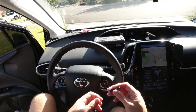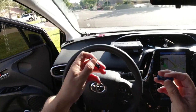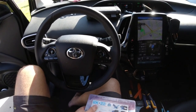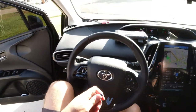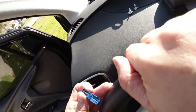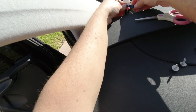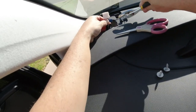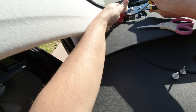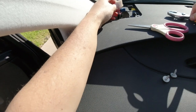We're going to take two of these connectors and crimp them onto those wires, and then we'll just be able to plug everything in and see if it works. If there are sparks coming from it, then we know I did something wrong and I'll end the video. Remember, the positive is the lighter of the two — the lavender and pink. I'm going to take this T-tap, put it around here, take your pliers, and crimp it nice and squared off. Crimp it together and we are good. That simple.